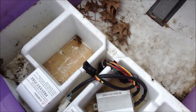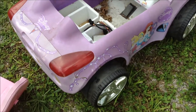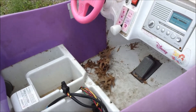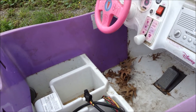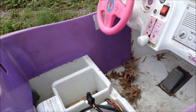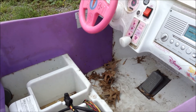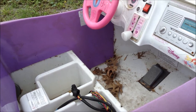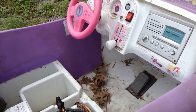Those are the most common problems with the Pontiac Solstice. Normally it's not the gearboxes or motors — it's usually the switches. If the switches are working, your motors are usually good and you'll have something happening. So if nothing is moving at all, it's definitely a switch problem. Anyway, thanks for watching.